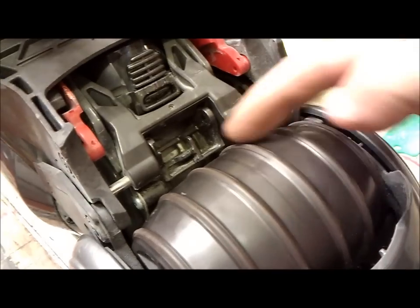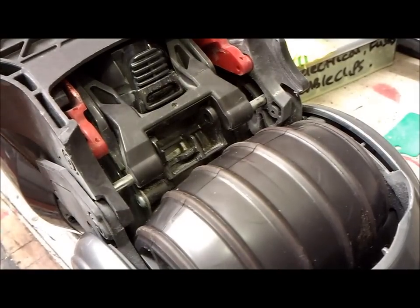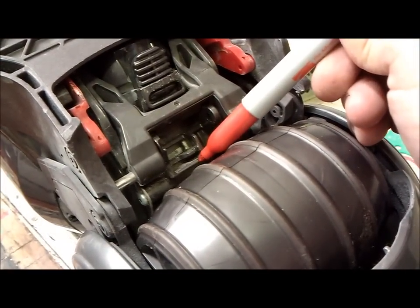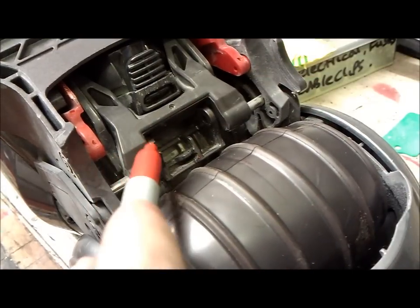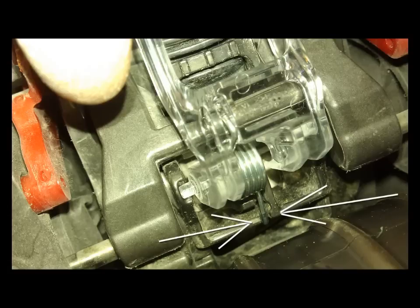You want to put that in first and then push the large lug in. You can see the slot at the bottom is right in the middle — that's where you want to put the other leg of the spring. Then on the right hand side we have the large hole, and on the left hand side we have the small hole with the leading ramp. So that's the last item to go in.